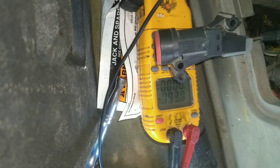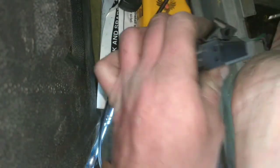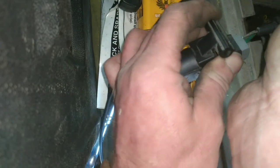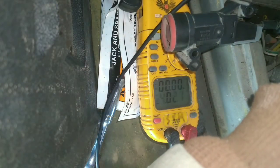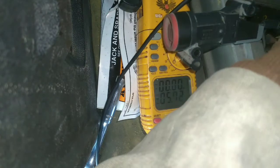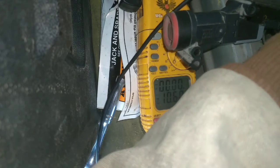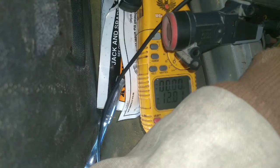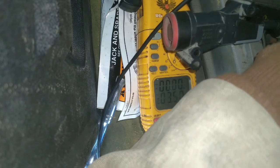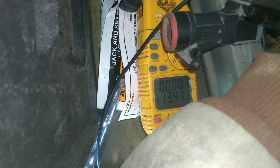Now with the van started and the switch closed, you've got 13.5 volts on the side with the green wire. The side with the white should be the same, or relatively close. Let's check our ground — it's jumping around but reading pretty close. You want it just about the same; you don't want a big gap in the voltage, as that could be a problem if you're trying to chase down a fuel pump issue.